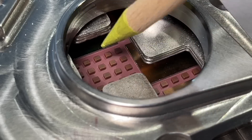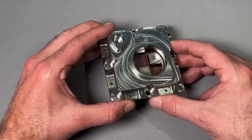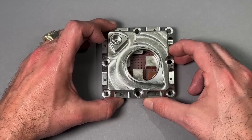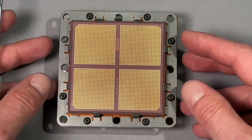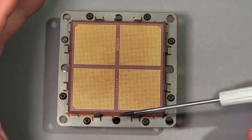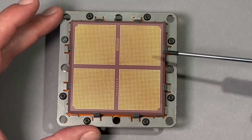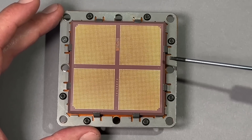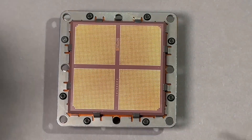What's strange at first glance is that it seems no metal part is connecting directly to the dies, which you would expect to see for proper cooling. But now I think it's time to disassemble that part to get a closer look on the inside. The MCM is held by this metal frame and these clips in the cooling assembly, so we have to remove just these eight screws to get these things apart.